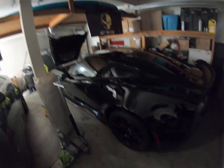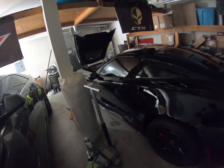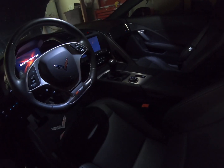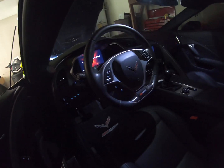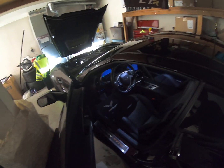It's got the best of both worlds with long tube headers and a catless X-pipe, which allows you to run a wide open exhaust, but then also silence it if you don't want to make too much noise. This car is also a 7-speed manual. I plan on swapping to an MGW short throw shifter soon, as there's better shifting with that shifter in this application. Other than that, there are no plans in the near future to modify this car, because I've got to get the Falcon done.